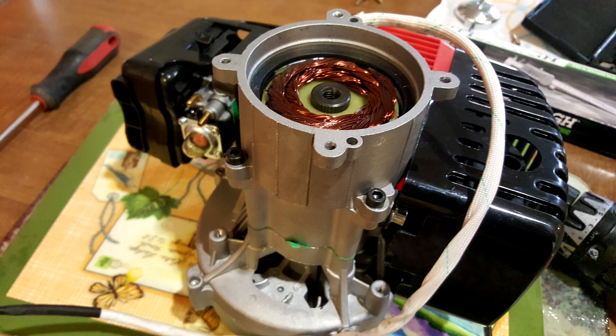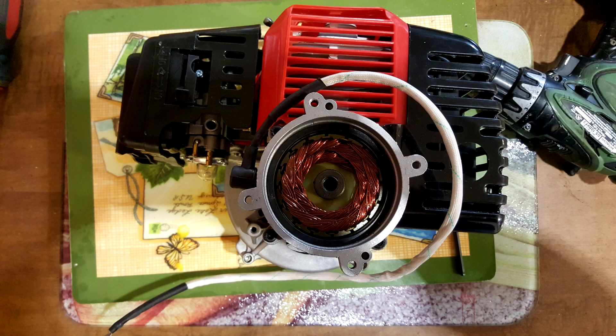The starter generates the electricity — it's a starter-generator. It puts out approximately 18 volts at top speeds and approximately 30 amps. I've figured out a new kind of charging system that actually works for these devices. Most people overcharge their batteries and blow them up very quickly, but that's for a different video. I've also found a way to keep these starters going and lasting a lot longer than normal — probably getting about four or five times more life out of it.